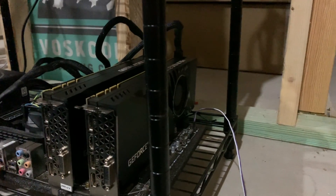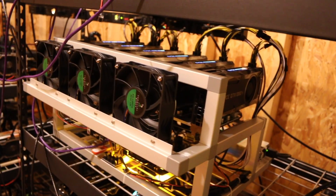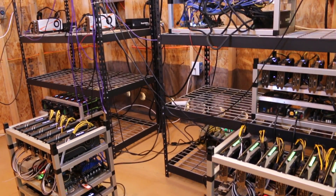Step one is to acquire a motherboard. You want a motherboard that can normally do at least six GPUs, and ideally has a couple of full-size PCIe slots - preferably two or three. This lets you put graphics cards directly onto the motherboard. Today's rig starts with only two GPUs but is expandable to six-plus. It's always great to have parts you can build upon - you take earnings from mining, reinvest to buy more graphics cards, and grow your rig over time.